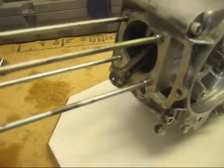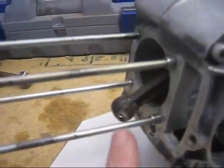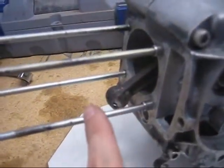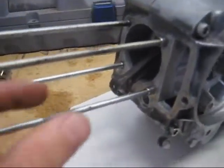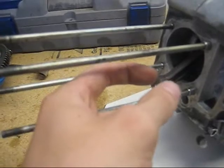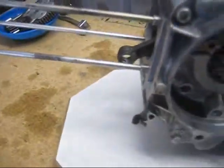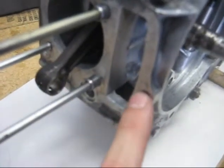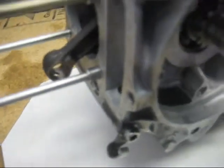After that, you'll have the cylinder. The cylinder will have a cam chain roller, and it'll be bolted up with a 10mm headed screw right here. You need to take out that screw slowly while holding needle nose pliers and pulling the roller out so that it does not fall into your motor. After that, you'll have to remove the cylinder anchor which bolts in right here. It has a combination of a 10mm hex head and Phillips head.